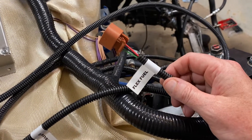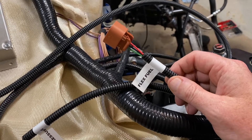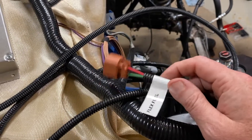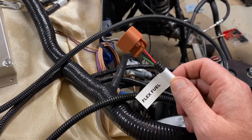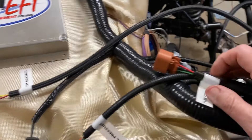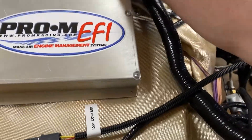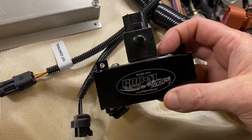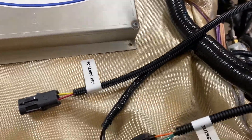I'm not going to be using the flex fuel because I'm not going to be using E85 — even though I'm using boost, it's just a pain for me to get it. But I could always add this sensor in the future; it's a very popular option and very easy to add later. Then the other thing is fuel pressure — that sensor I talked about earlier. This is not for your fuel pressure gauge; it's a sensor input to the computer looking at the pressure across your injectors.